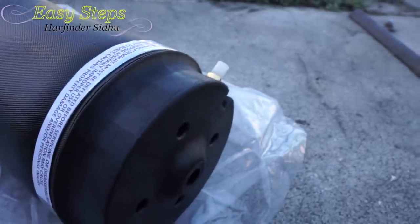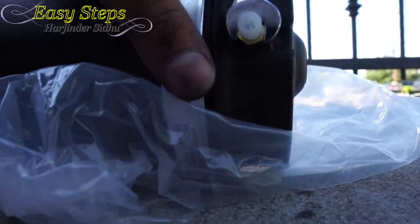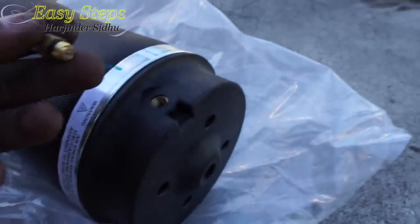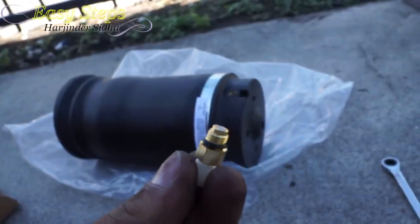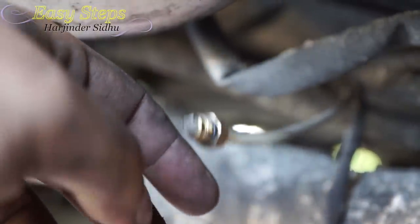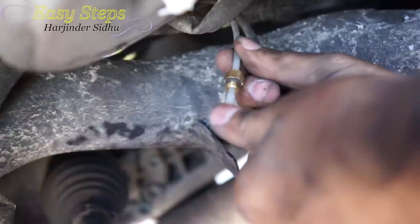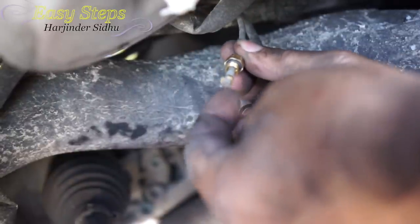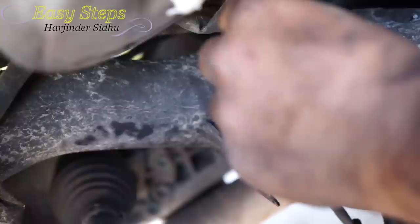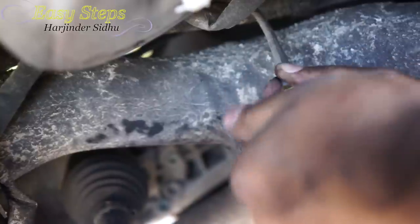Here's my new airbag. The new bag comes with a new fitting for the airline, which I'm going to remove. Now that this is removed, I'm going to replace it with the old airline fitting. I'm going to remove the old fitting from the airline and push this piece upward — there's a gap now and this one's going to come straight out. Now I've got the new fitting on, and I'm going to put the small ring on and just twist it.